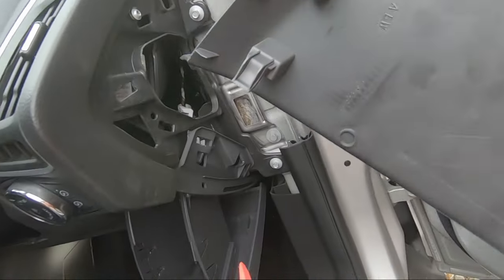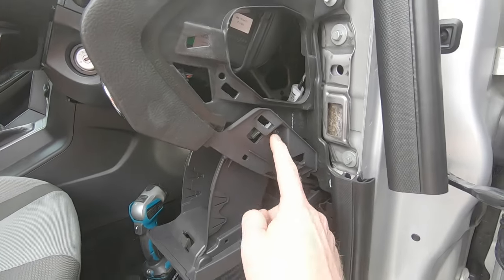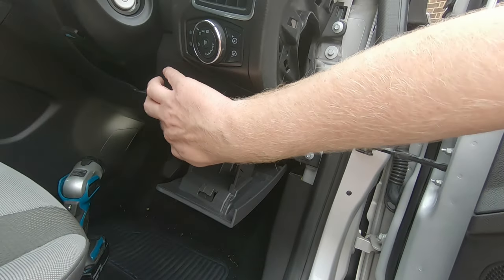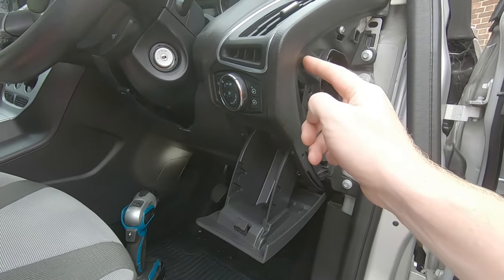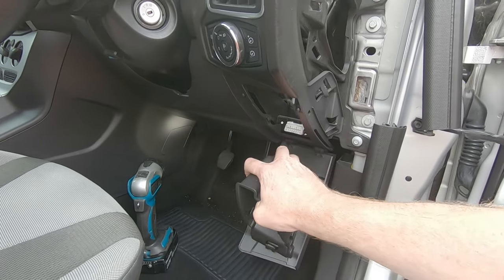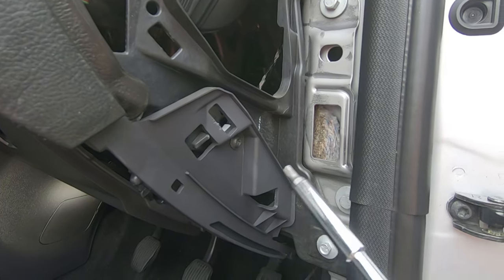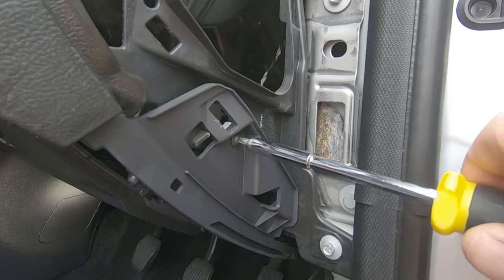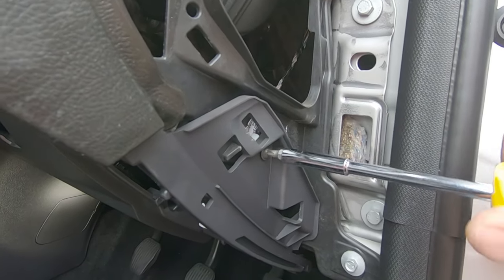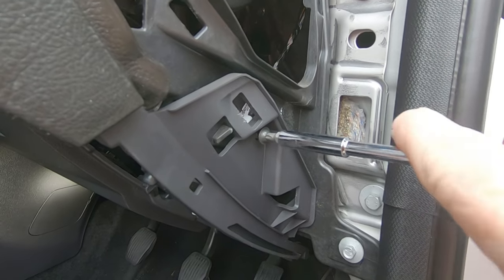Now you have the side panel off the side of the dash. Then you have this screw in the side here which attaches this panel to the main part of the dash. You can take your coin purse out - it just clips down there with a squeeze at the sides. It's a T25 torx bit, because obviously posi drives and flatheads are far too easy to work on, so they had to make everything complicated. We'll just whip that out.